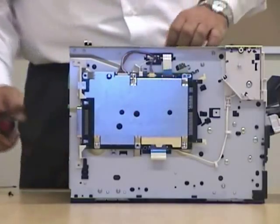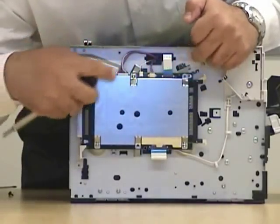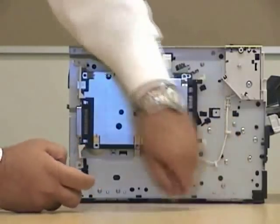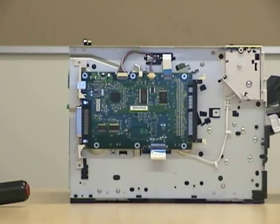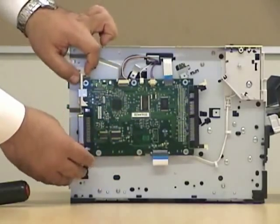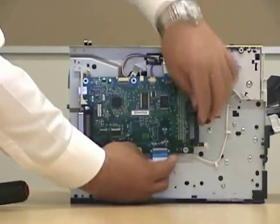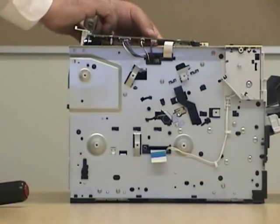First I'm going to remove this unit — it has a lot of screws, about seven screws on the sides and the middle. Those have to come out. Now the printer card, where it holds the peripherals and the USB connection — you don't have to remove it completely. All you have to do is just remove this wire. Be very gentle in doing so, and then you can flip the card out of the way.